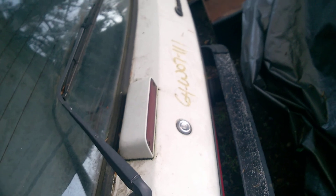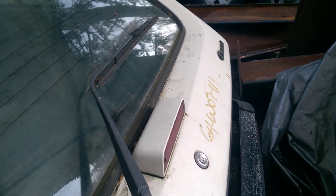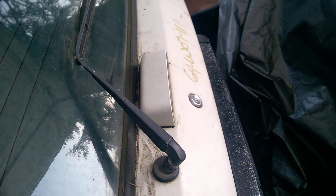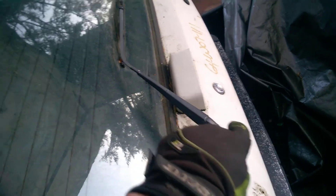Come around the back — you can see the new hatch is on. I also had a fun time playing around with the key on this thing, because this hatch came from a pick-and-pull yard and didn't come with a key. So I took the lock cylinder out and the lock cylinder from the parts car, pulled the pin lid off, and very carefully swapped the pins into this one. Flipped them around again so it works with the key I have, and now I'm able to open it up. So that's really nice.